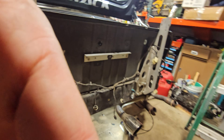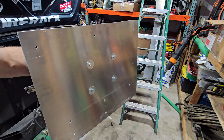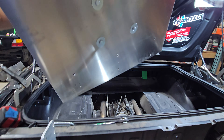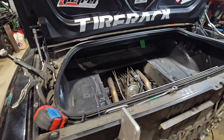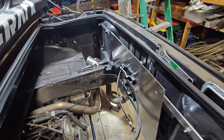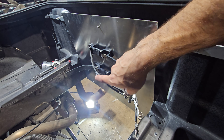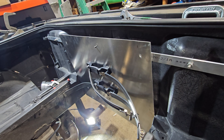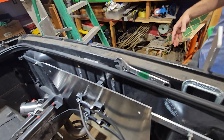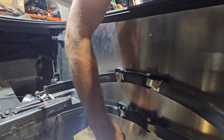I'm gonna need to do the same to this one and this one so I can take it off if I need to. In here I have rivet nuts - or insert nuts, whatever you want to call them - into the frame down here. What bolts to that is this: just a flat piece of aluminum. It should sit just like that. My plan was to quickly get this mounted - it bolts to all those rivet nuts down there, bolts in there, here, and the other side to give it strength. Then my tank mounts right in here.